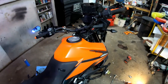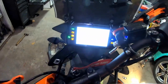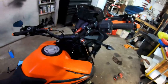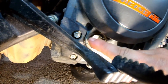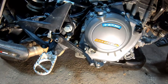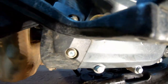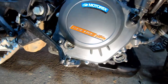Now that the oil is full, just before I reinstall the skid plates, I'm going to start it up, make sure everything's good, and give it a minute to make sure no leaks are happening. After letting it run for a minute, I'll quickly check the oil level right down here at that sight glass. You can see there are two different lines — the oil level just has to be in between them when the bike is standing straight up. Since it's on the kickstand I'm just going to lean it straight and yeah, the oil level is between the two lines so we are good to go.